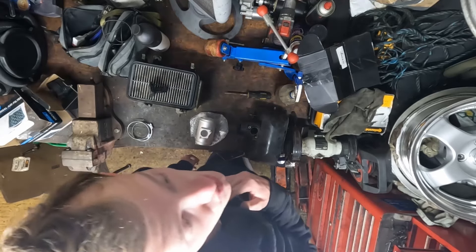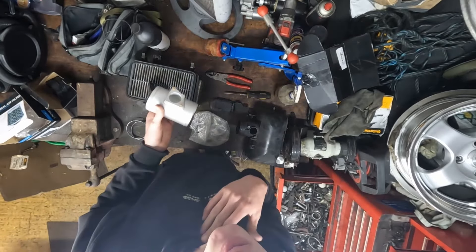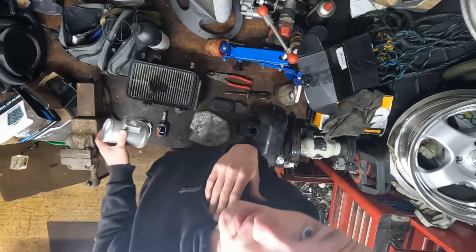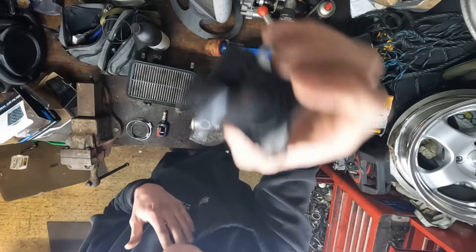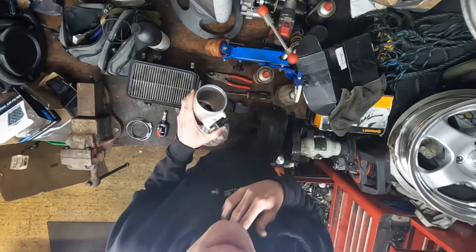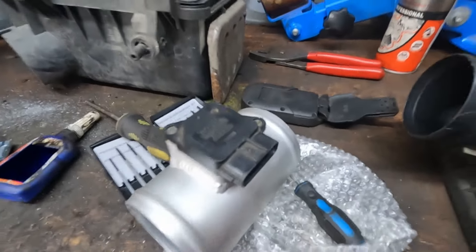I needed to find some different screws. Found some bolts and lock-tited those little thingamajigs as well - don't want those coming loose, because I've had problems on the MR2s before when they come loose and it runs terribly. I've also cleaned the MAF up because it was dirty, which could be why it's been running a bit rubbish. Let's get it fitted in - I think that seal needs a bit of grease. Right, the MAF sensor is fitted into the housing. Looking good!